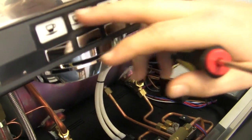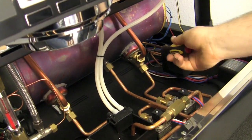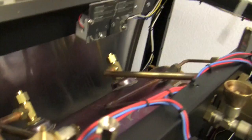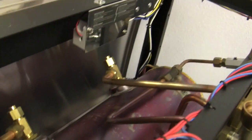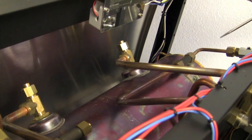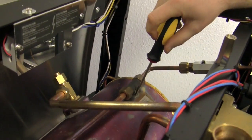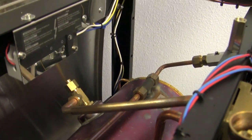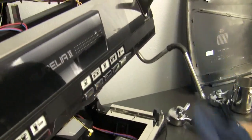So that's the whole process of how water makes it through here. When you hit your button, water goes around your flow meters, through the heat exchanger, out to the group head, through your three-way solenoid, and out into your cup. The other two tubes coming off the top are taking steam for your steam wands — you've got your water intake at the bottom and your steam off the top. Steam comes straight up right through here up to the steam wand. That steam is directly connected to the internal of the boiler — it's just one easy, easy line going through.